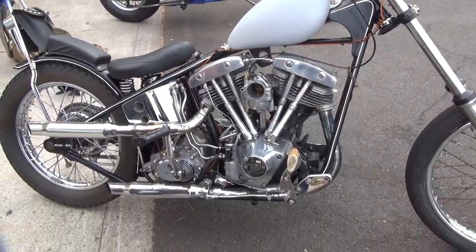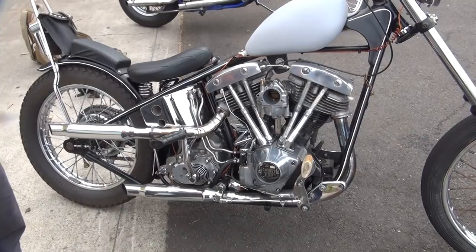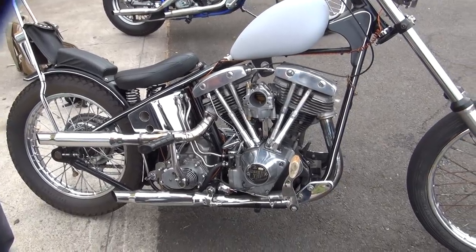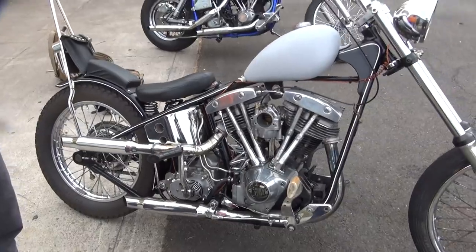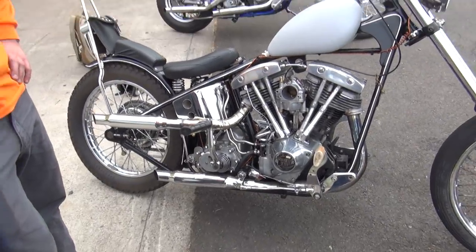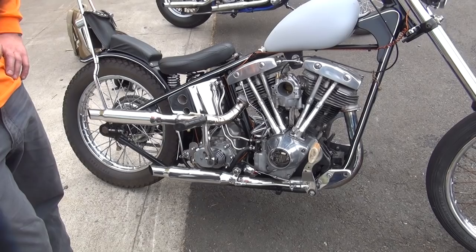Well, it only has so much this way and that way. What is the light really telling me? It tells you when the ignition fires. On top dead center or something? It comes off the top dead center mark. On yours, his comes off the timing mark, which is different. I could just put a little paint mark on my piece. Well, find it. What year did it start coming off the timing mark?